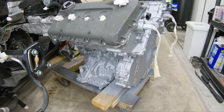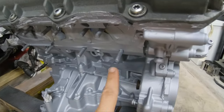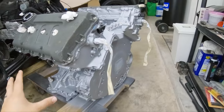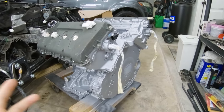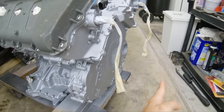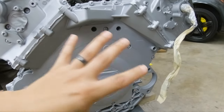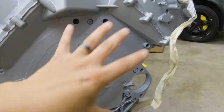From the last build, I remember I installed all the accessories first, and when it came time to put on the headers I found out I couldn't access those bottom nuts. So I had to remove all the accessories from both sides, put on the headers first, then put the accessories back on. This only applies to the side accessories — driver's side and passenger side. As for the clutch and the crankshaft pulley up front, that doesn't matter, since the headers don't really affect those. So I'm going to install the clutch first so I have the widest range of motion with the ratchet, then put on the headers.